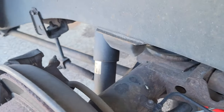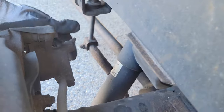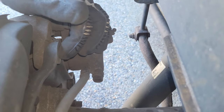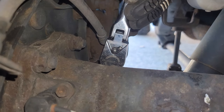Taking a look at our brake components here. We have the brake line which feeds into the banjo bolt — that's how our brake fluid gets into the caliper. We have these two 14 millimeter bolts that hold the two pieces of the caliper together, and these larger 17 millimeter bolts that hold the actual caliper to the hub. Up in the top center is the bleeder valve, where your brake fluid would be bled out when you're doing your brake bleeding.